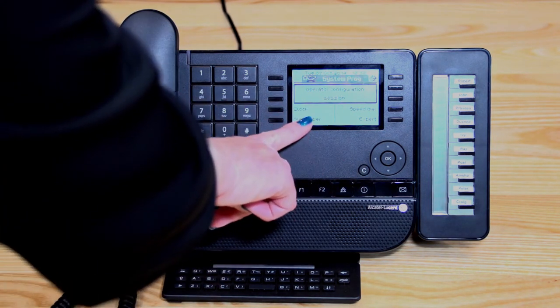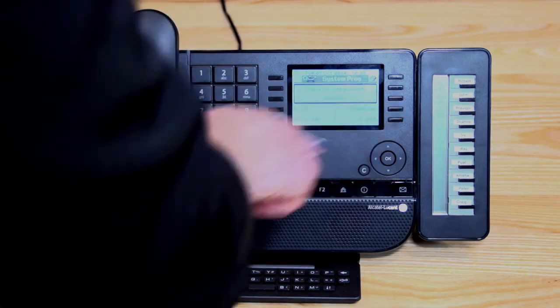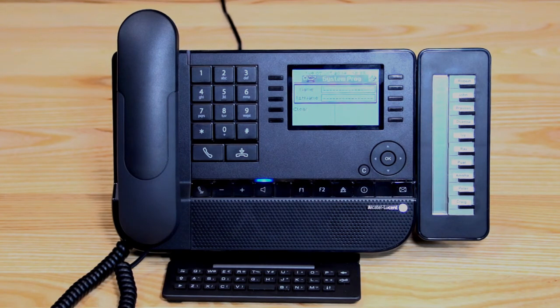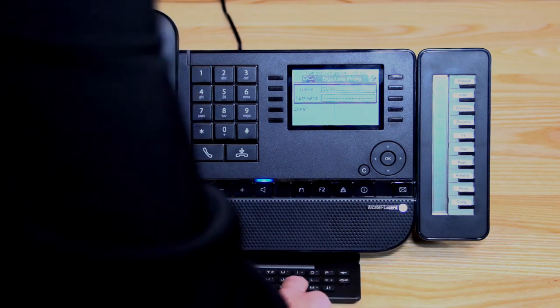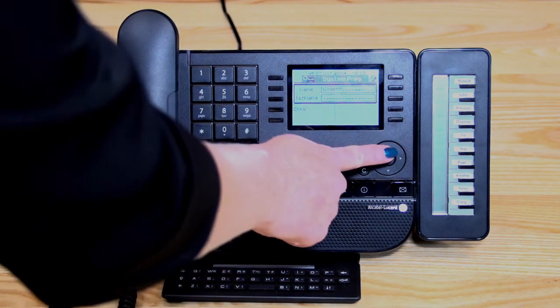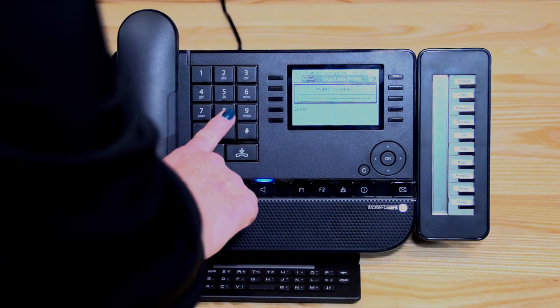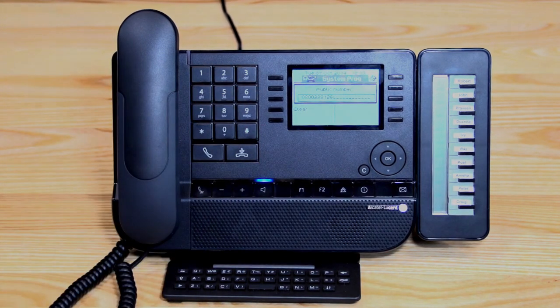So we've been into clock, we've been into subscriber. If I wanted to put a speed dial in, I could go speed dial, new. I could put the name in. So I'm just going to put Cogent in here. Press OK. And now I'd enter in the telephone number. There's no need to put a 1 in for an outside line. And then press OK. Alright, so I've now programmed in that number.